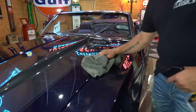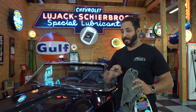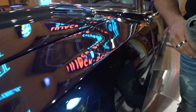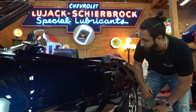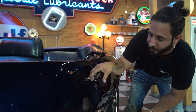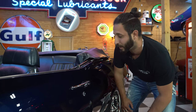Just like all of our other vehicles, just checking some of that paint over here — it's got a lot of swirl marks in it. I can't tell you how many times we get a vehicle in that, 10 feet away, looks great, but when you get up close you're going to notice a lot of water spots in this paint. I don't know if somebody left this next to a sprinkler system or just hard water. So we're going to take this baby down and give her a nice color sanding, a nice buff wax and a wet sanding. Whoever painted this car really did a nice job — you can especially tell getting in and out of the car, but if you put your hands in here with any rings, it does leave scratches. So we're going to take all that out, give her an awesome detail and make sure she's gleaming.